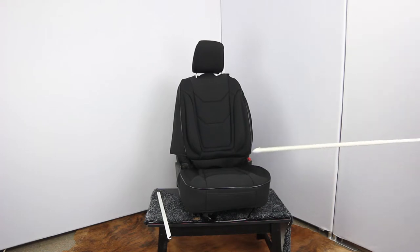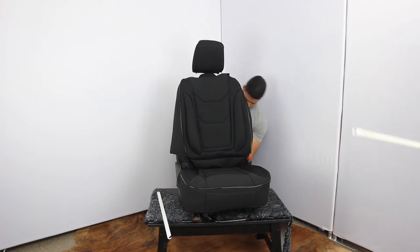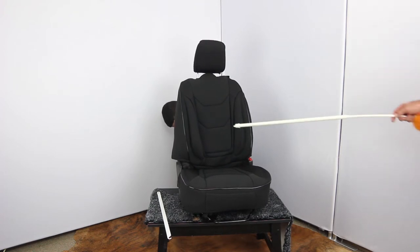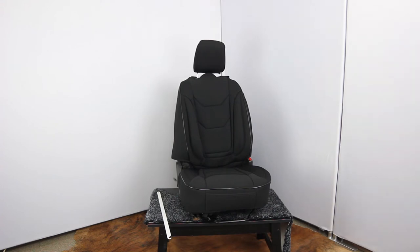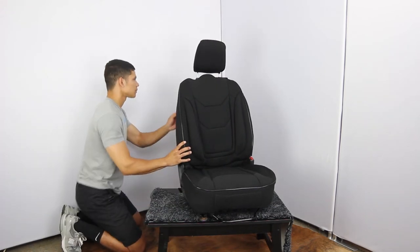The second strap goes through the exact same process. You might want to pull that down a little bit if you can see any bagging — it's a real common thing. Come around to the front and pull it down. What you want to do is maximize the length by just pulling it, so the seat back mates up perfectly with the seat bottom. Every car and truck is a little bit different; this one here happens to fit pretty close.